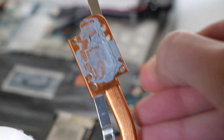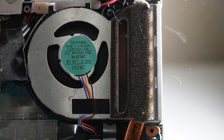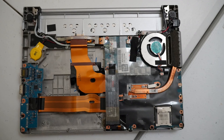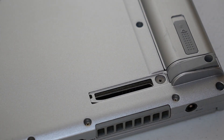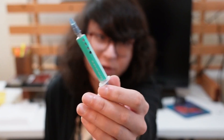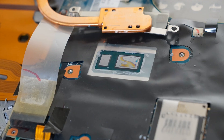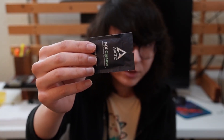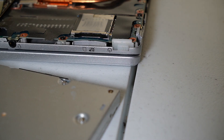When it came to repasting, the original thermal paste was dry, but what surprised me was the amount of dust. I dusted off the fan before the reinstallation, but there's also a slot on the back of the laptop where you can dust off the fan without any disassembly. Side tangent: I reinstalled the system with the new Arctic MX-6 reformulation and used their cleaning wipes. The wipes leave an odd residue, and the paste is difficult to spread evenly compared to the older version — I might have just gotten a bad batch, but either way I should put out a warning. And don't forget to check that the power switch plastic hasn't fallen out before reassembling the computer.